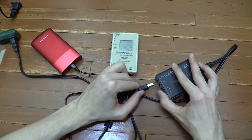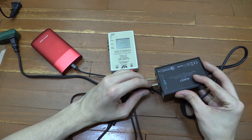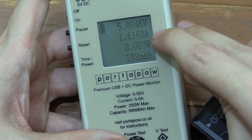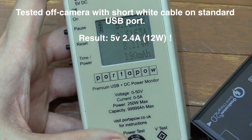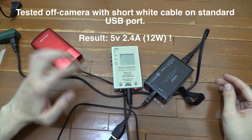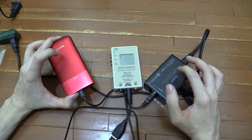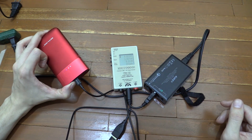Now let's say you don't have a quick charge port and just have a regular USB port — we're charging at around 5 volts, 1.6 amp, around 8 watts. That's pretty much standard for a power bank. A lot of power banks can do 2 amp charging at 5 volts, so nothing special there. But when you connect it to Qualcomm Quick Charge, that's where it absolutely flies — that's why you can recharge such a big battery bank in just a few hours.